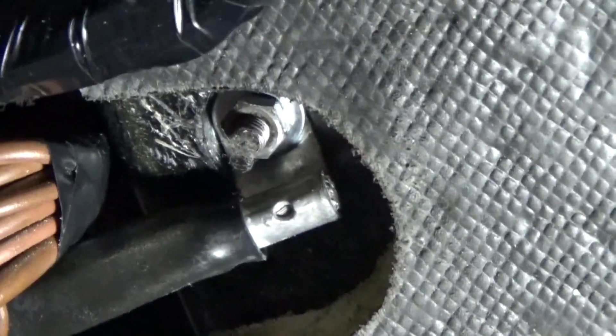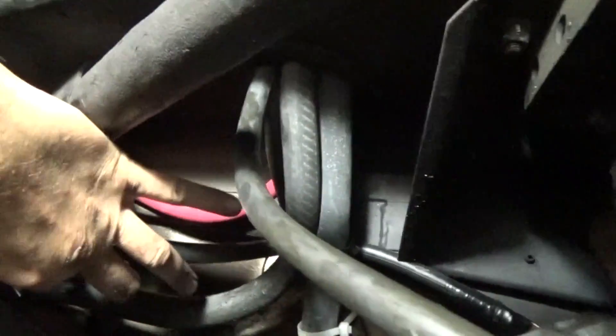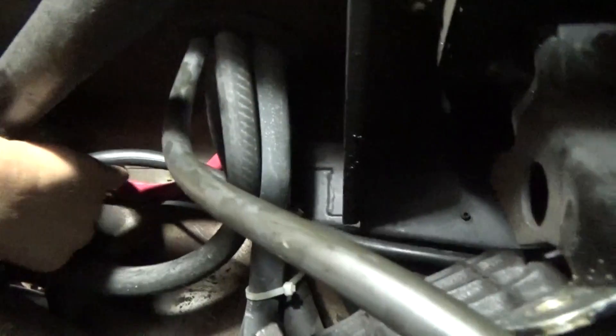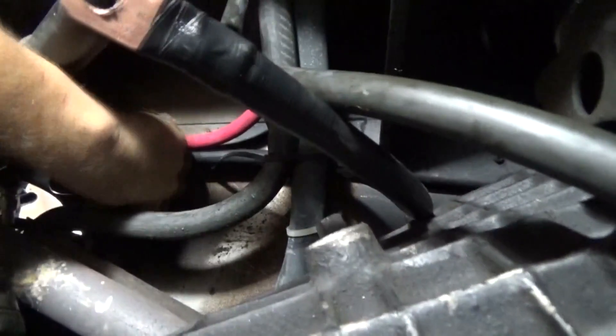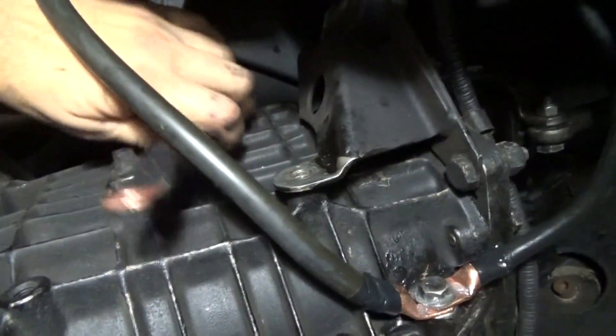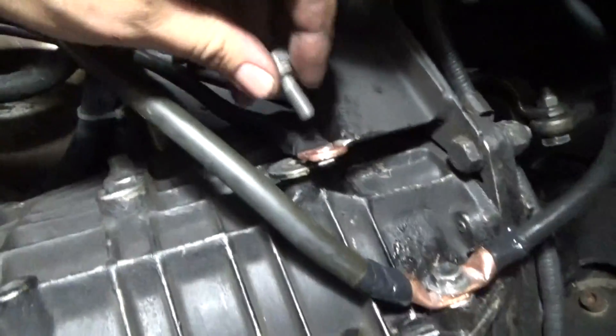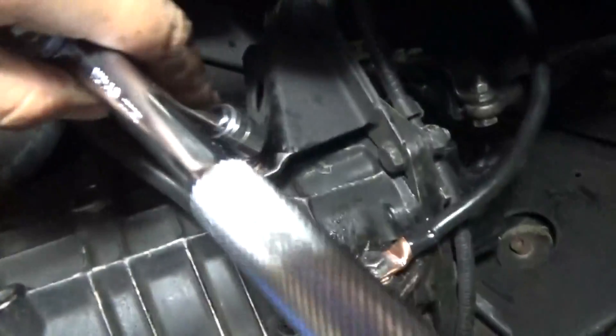Now we're going to go underneath the car and make the connection to the transmission. Here we are underneath the car and we're going to route the new ground wire over these hoses and right next to the 12 volt battery cable that I installed previously. I'll drop a link in a card and also in the description — that's a video on how to upgrade the positive side of everything from the alternator all the way to the battery with zero gauge wire. I'm going to make the connection right here. John Hervey would be proud. Tighten this up and then factory spec torque it.